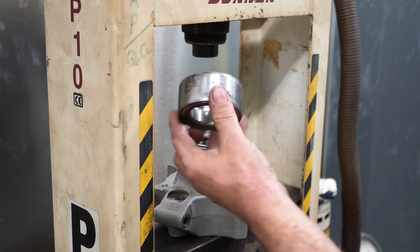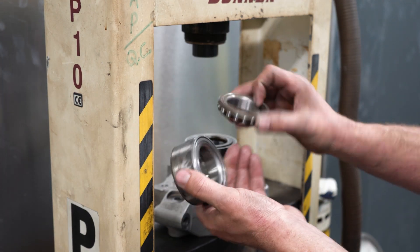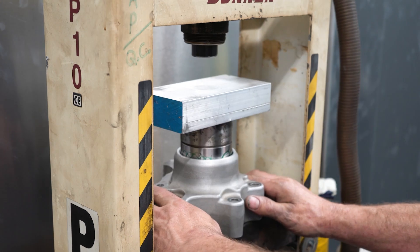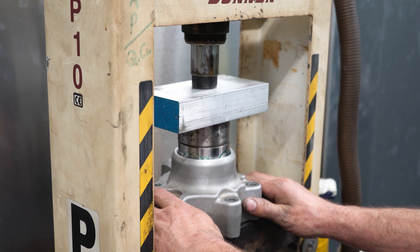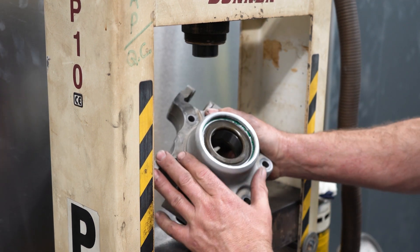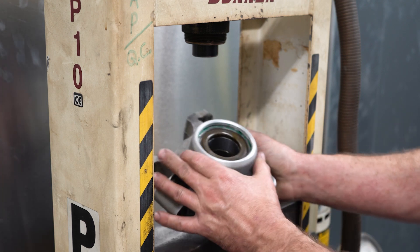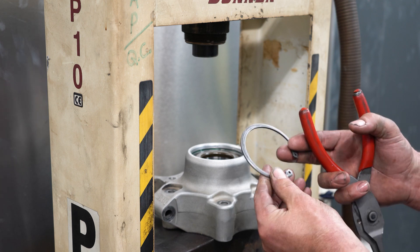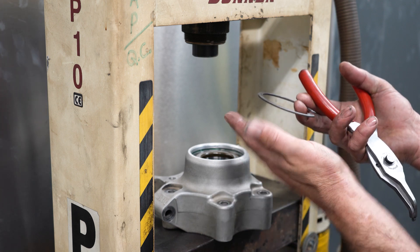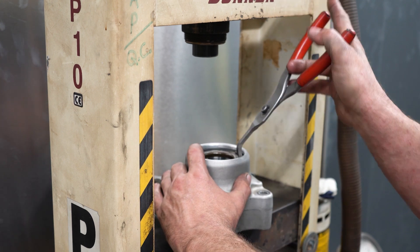What I've got here is the old wheel bearing that I've removed one half from simply with a pry bar — just pop this end right out — and this is actually going to act as a perfect pressing tool for our new bearing. Make sure that your bearing is all the way flush with the snap ring ledge. Now install the snap ring with the flat side down towards the bearing and the tapered side facing up and out.